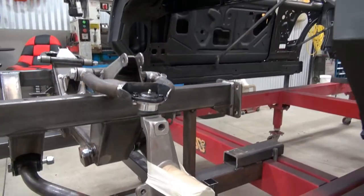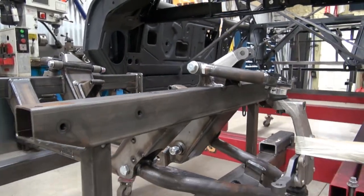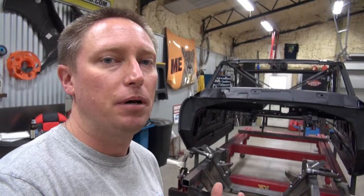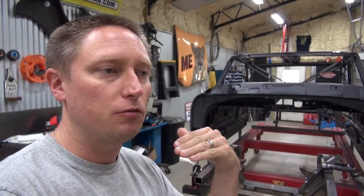Next up, got to get the motor mounts in the car, the motor, pull one of the headers off of the Camaro, see how everything fits up, where it's going to be vertically located with the header and so forth, see whether or not I'm going to be able to use those headers.